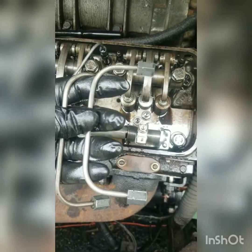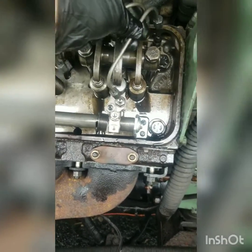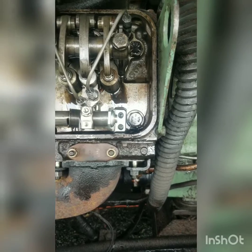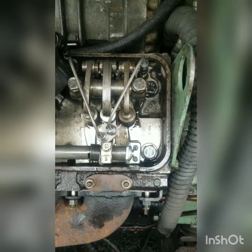When you put your fuel lines back on, you don't really need to worry about if you have the right one or not, because if you look, they are actually different lengths, so they only will go on one way. Just go on like that, tighten down to about 20 to 25 foot-pounds, and you should be good to go.